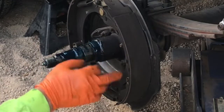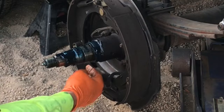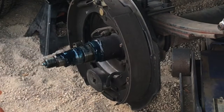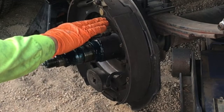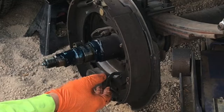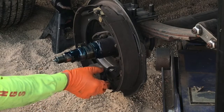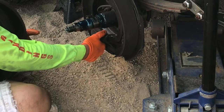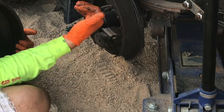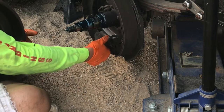It's a good time to look at your drums — make sure there's no bad grooves on the side where the magnet rides and the shoes ride. My shoes were almost in brand new condition. You always want to look at your shoes when you have the drums off to make sure they're not heat checked. There will be cracks, and that's usually from somebody having the gain up too high on your trailer brake controller. Also on electric brakes, there is always a left hand and a right hand brake assembly. You want to look at the bracket that holds your magnet — it should always be curving around the front of the axle. If it is curved around the back of the axle it is incorrectly put on. Once you step on the brakes there's a zero to 12 volt reference that goes to this magnet, the magnet adheres to the inside of the drum and pulls — that's what applies your brakes. The trailer gain on your brake controller, the plus or minus, just gives a greater or lesser voltage and that's how much braking power you have at the magnet.